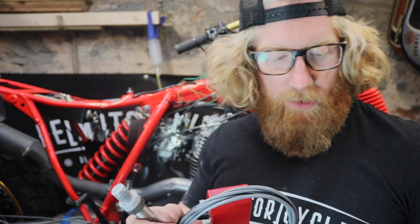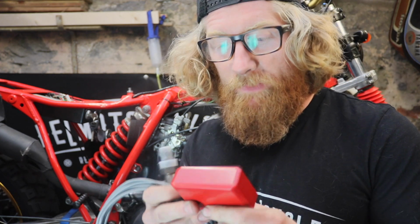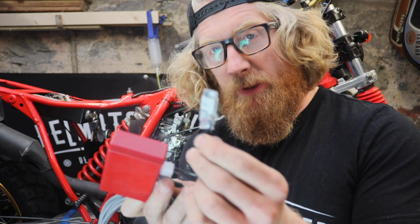So this is my Lambda sensor. This is some of the other stuff that comes with it. I think this is the control module, and because I've opted for the wireless system, it comes with this little Bluetooth thing. I'll do a full rundown in the next video, don't worry. But I've got a 12 volt supply here, which will plug into this as well. So what I'm going to do is plug the Lambda in, turn the bike over, fire up the app, and get everything speaking to each other. I'm not going to do any tuning today, I just want to make sure we get the signal that we want on the phone. So let's give it a try.